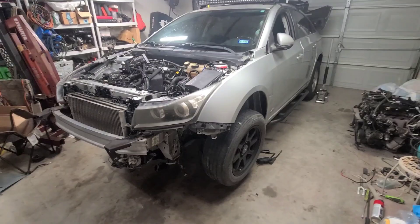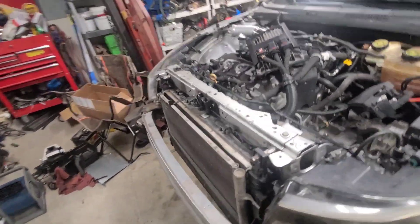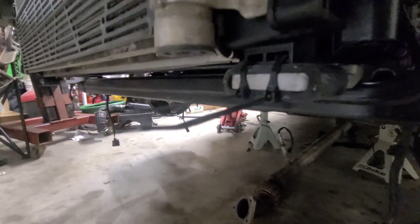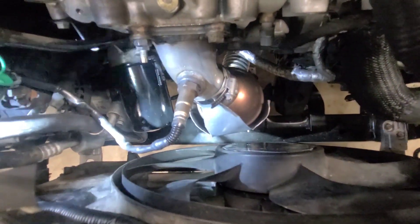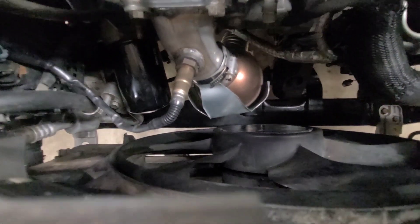I'm back. I'm starting to get a little bit of the car back together. I've got the radiator, the condenser, all that stuff hooked up. The air conditioning I'm still going to have to work on. All my coolant lines are hooked up and I've got all the air bled out of the system. I did have to scoot the radiator out — made some spacers and worked with what I had. On the bottom, I drilled a couple of small holes into the base of the radiator foot, ran some zip ties, and wedged a piece of radiator hose onto the end of that platform. The reason I had to scoot it out is because the exhaust was touching the fan. I've got a little gap now and made my own little heat shield on the catalytic converter, and also put some heat tape on the front of the fan in hopes that it'll keep itself from cooking.